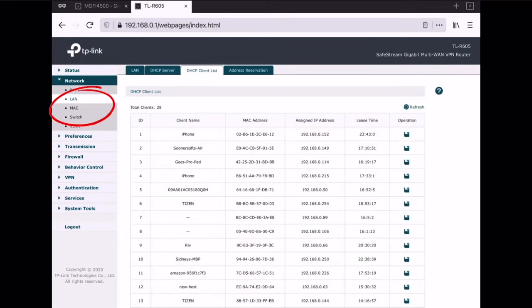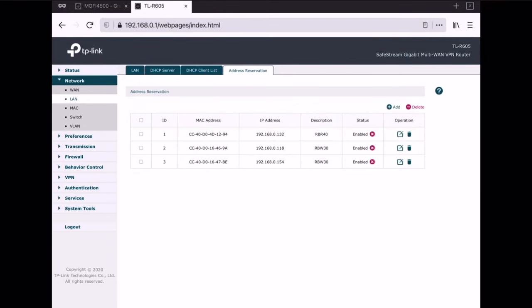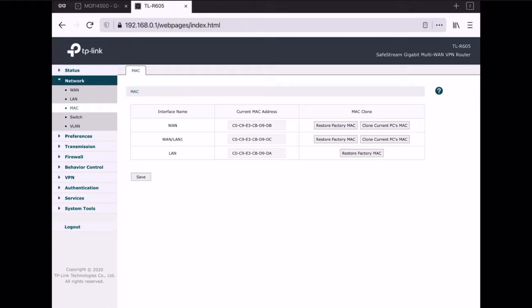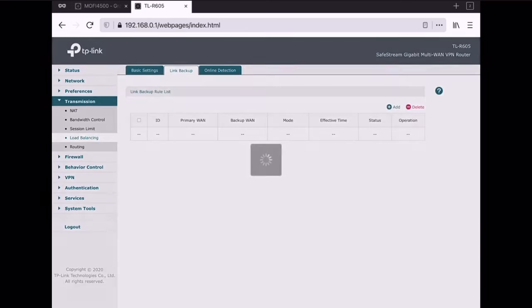You've got the drop-down menu where you can see the network, and configure the WANs, how many WANs you want. You can put up to 4 WANs on this one router. As a default on the TP-Link router, load balancing is turned on, but you can turn it off. You can use it as failover only, or you can select certain IP addresses on your LAN network to only route traffic through certain WAN inputs, or you can choose which input you want to have the heavier load and which one you don't, or you can just keep it load balanced as the default.